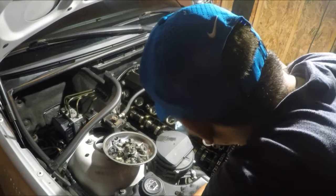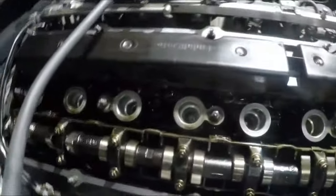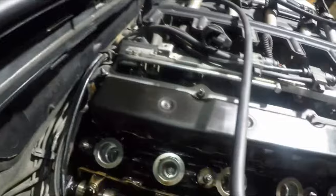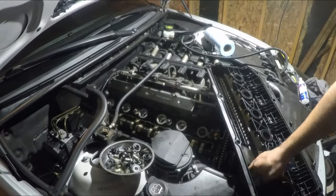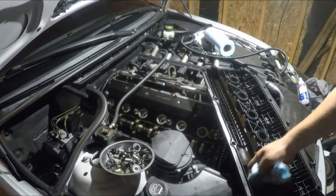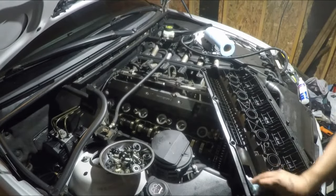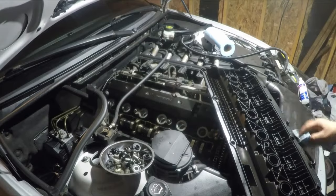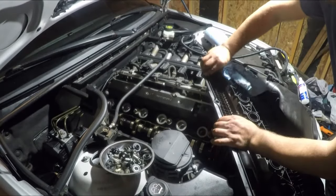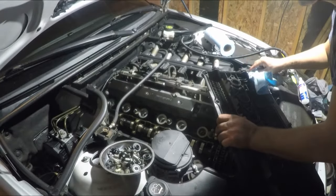Same thing for the O-rings — where the O-rings go, give it a quick wipe and then inspect to see if you need to do any more cleaning. My engine looks pretty good. Also don't forget to clean the inside of the valve cover if there is any dirt or thick oil, especially around where the gasket is going to go. In the groove where the gasket sits — don't forget that, otherwise you might get a leak because the gasket might not be sitting properly.